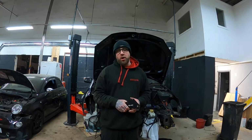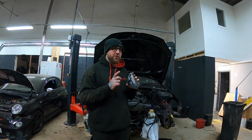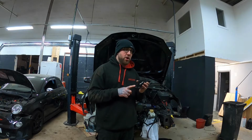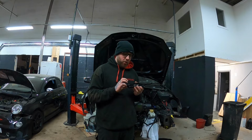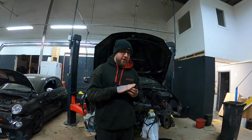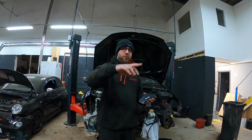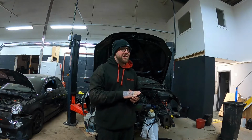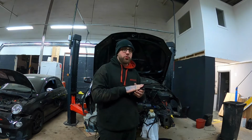the new style cooler. But what I will just finish up first is, one of the other problems with these ones is, not only does it not warm the oil up, it's under somewhat of high pressure. It's not the exact pressure that the clutch sees, but it's still part of the higher pressure circuit of this system. So that's why you can end up with leaks sometimes, and not only that, you're making it travel a long distance with the oil pipes and the cooler. I don't know how much of a problem that actually is, but I've spoken to a few people, and it seems like motorsports companies do not use this type.